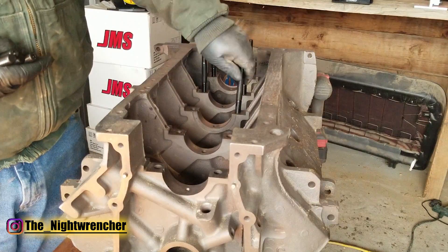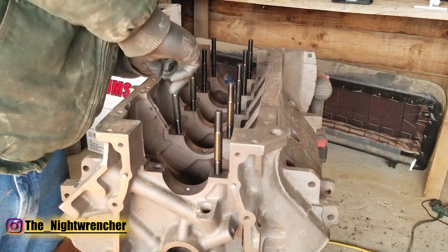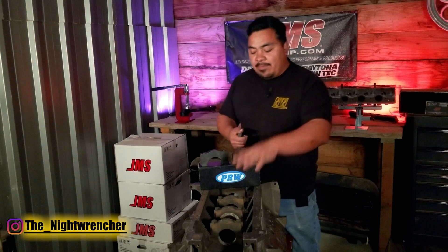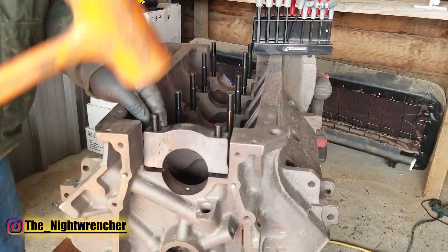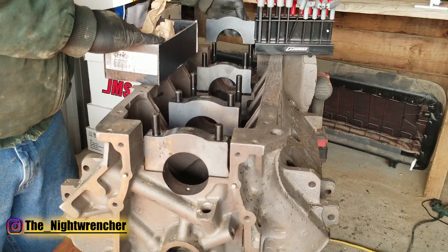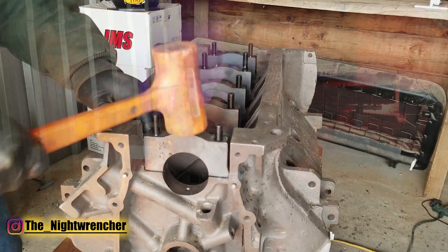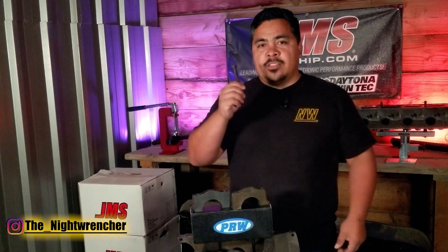For example, if you send the block in with stock hardware torqued to the stock spec and then pick it up and replace that with studs, those studs are going to require a lot more torque than the stock bolts, introducing more deformity into the block. When everything is torqued down and the engine is line bored, it's bored to the deformity it has at that moment. You really don't want to introduce any other deformities into the block afterward, because that pretty much ruins the entire point of why the engine was line bored and line honed. As it relates to the billet caps, you really don't want to use the stock hardware on them — because now that the billet caps can take the abuse, the weak point moves to the bolts.